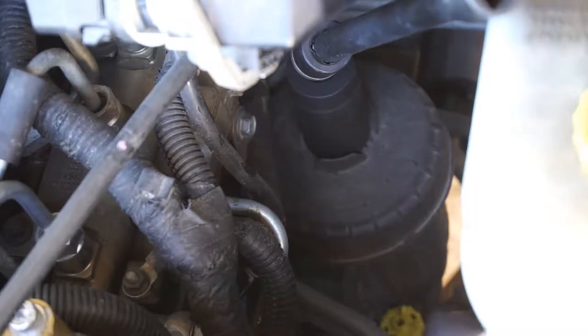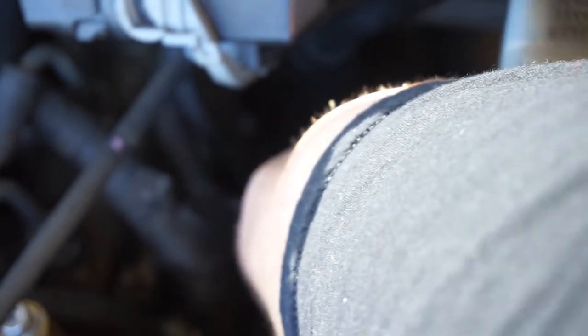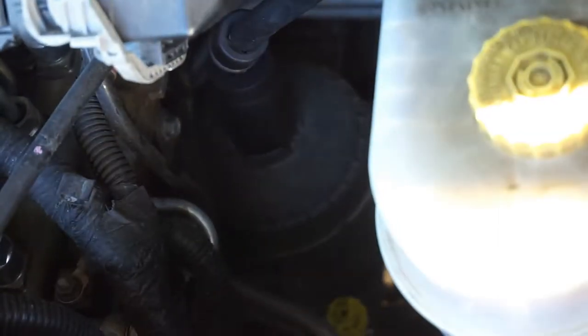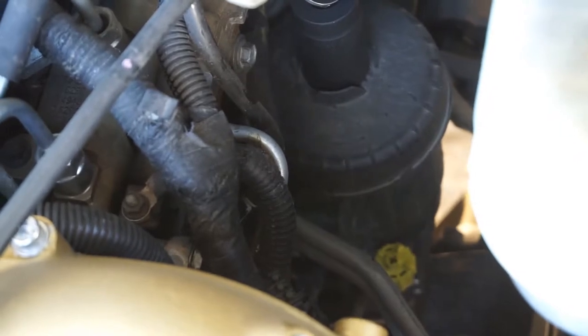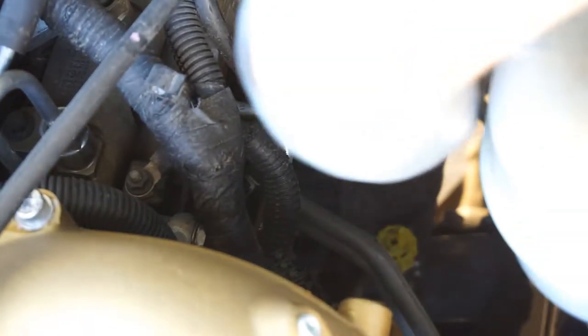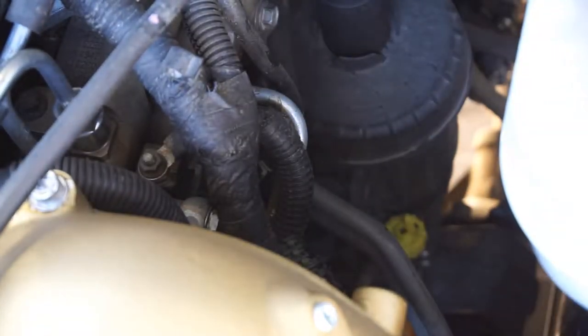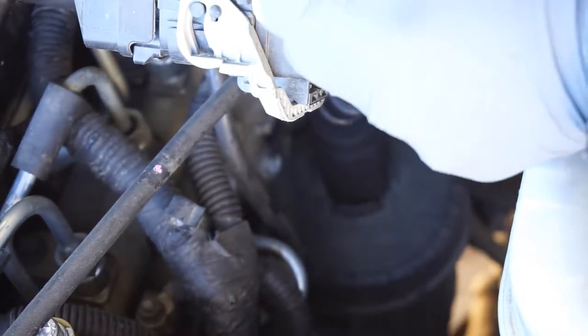This yellow thing is your water/fuel separator — just turn it to drain some fuel out. You can see that down there. I'm just bleeding it out a little bit, nothing too crazy. I'm going to turn it off because I want to keep some fuel in the bowl. You just need an extension and socket. I haven't broken this loose yet — just make sure it's on there straight because it's plastic.